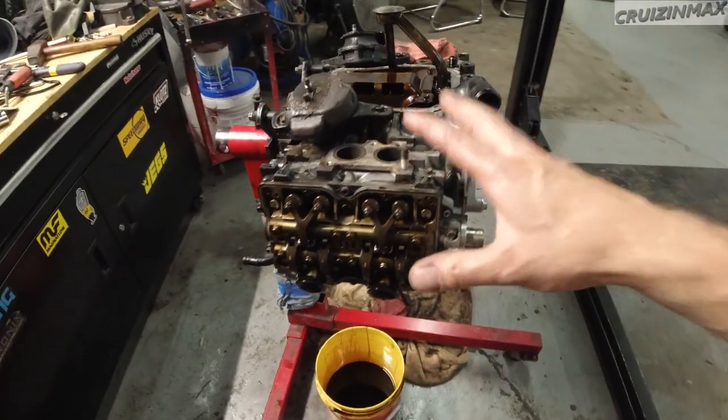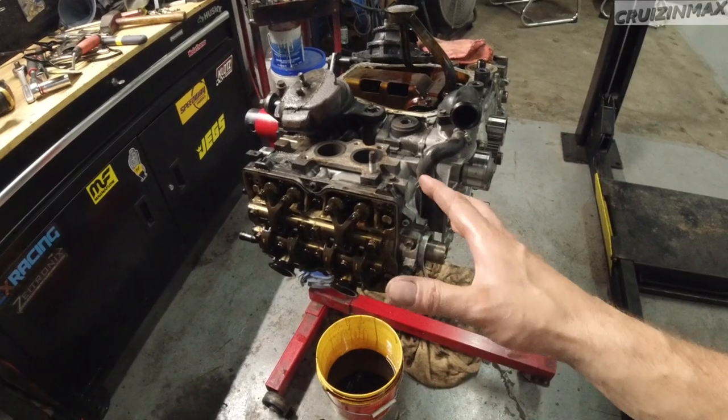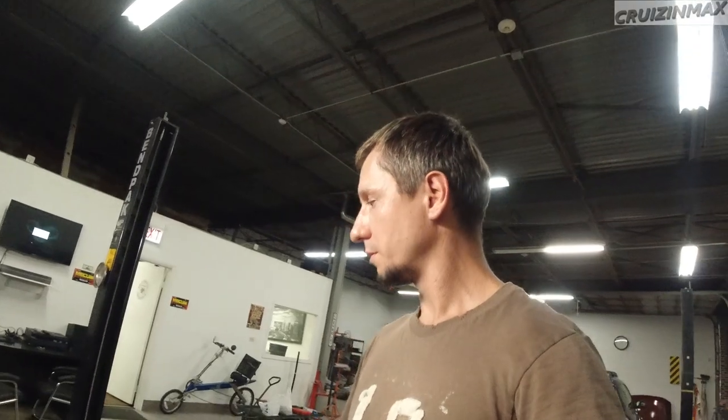It is late. People gotta eat and sleep, but this is the state of it now. Now, I forgot to mention, if you're doing a leak down test, you gotta be top dead center, which means all valves closed in any way possible. So you can take off the timing belt, valves will close. But the best way is to remove the rocker assembly, then for sure that's gonna be closed. If you're not sure that you're taking it all apart, then you might as well do the belt thing and just find top dead center and turn it halfway for the next cylinders. The firing order is 1-3-2-4. So if you go halfway on the crank sprocket after TDC, then you would check cylinder number 3, and then 2, and then 4.